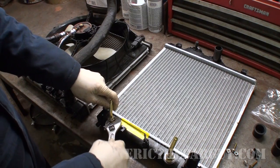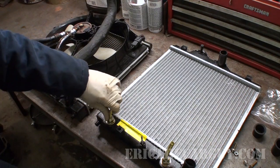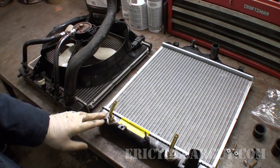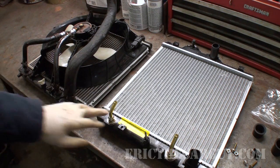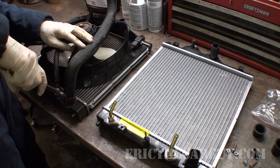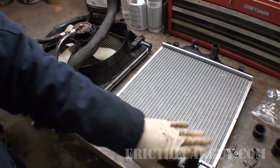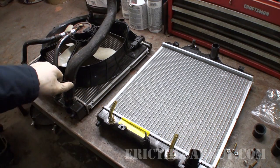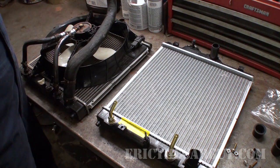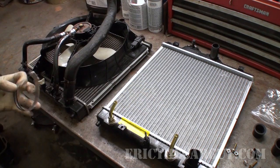Done — and done. Like I said, it's a compression fitting, it should be fine. Just try to get your angle right. Now I will transfer the hoses over. If you're going to add a hose clamp to anything, I would do it to the bottom hose. This one is fairly rusty, so I'm actually going to opt to replace it. I say this because these spring clamps will get you, especially if they're old and rusty — they will not hesitate to wreck your day.